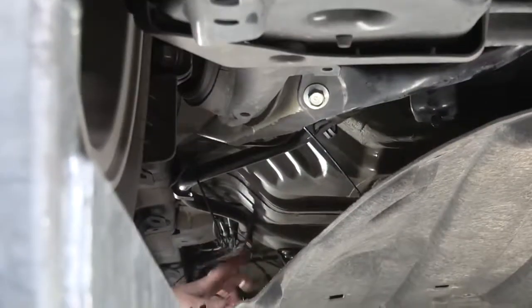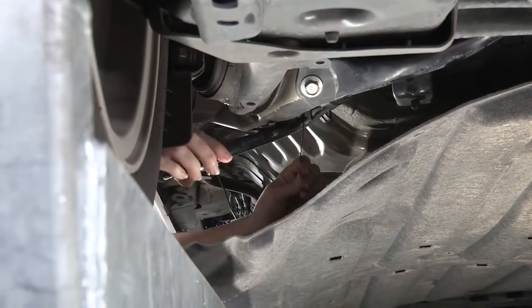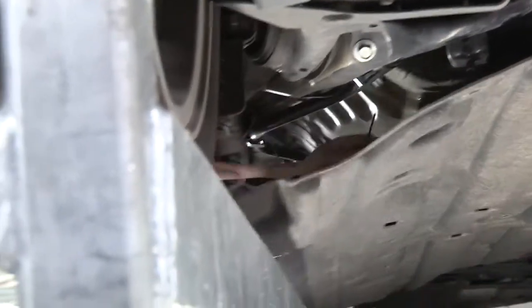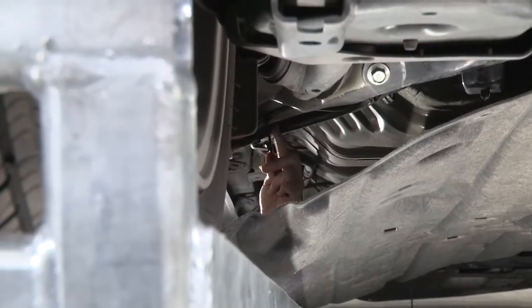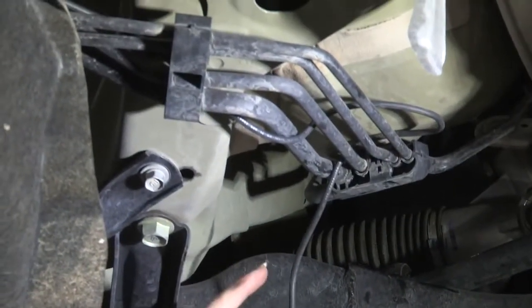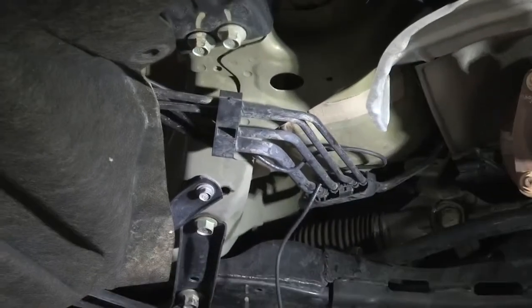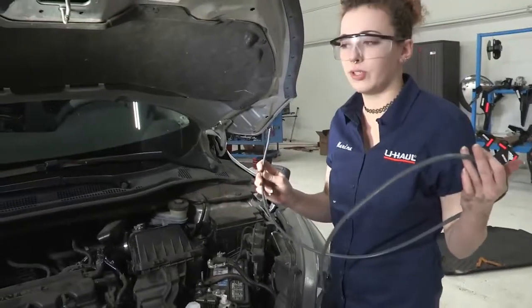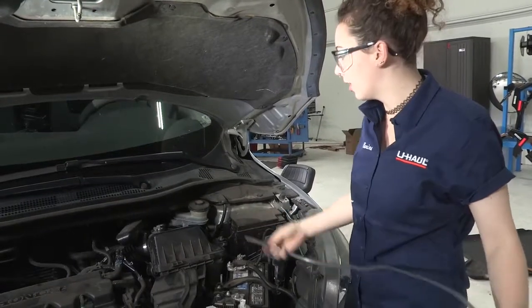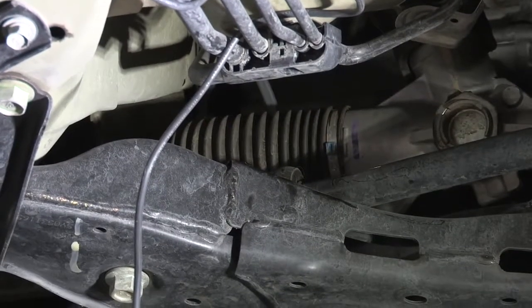We've already gone ahead and secured this wire all the way up to the front of this cover. You can see we followed the brake line all the way up along this path. I'm just going to go ahead with these cutters and clean up these zip ties by removing the ends so that if this cover ever comes off, it'll still look nice. We stopped right at the base of the firewall here — we're just going to follow these brake lines up to the top of the engine compartment. We're going to run a wire from the top down below, secure it to the end of our wire here, and pull the end of it up so that we can get it connected to the battery. We're going to use this gray wire just as a tool to attach to our black positive wire on the underside of the vehicle, send it down below the brake reservoir, and then tape our black wire to it so we can pull our wire all the way up to the battery.